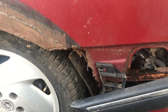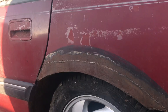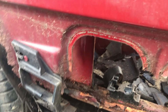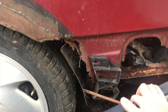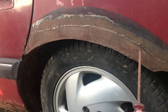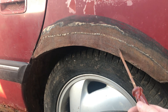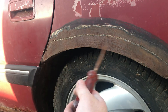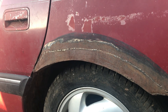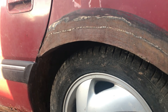I haven't committed to restoring this car — I'm still at the investigation stage, trying to work out whether this is a parts donor or a viable restoration proposition. When I say viable, I don't mean you'll make money off it — I mean can I be bothered to put the work in to make a semi-decent car without it being a complete hodgepodge of patch welds. This whole area is gone but the actual main structure of the wing is good. There's a wheel lip repair in there which I'll pick off. All Senators and Carltons are probably going to need work in that area anyway — that is a horror show. You can still get pattern parts off the internet but they're really expensive and apparently they don't fit so well.